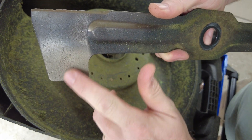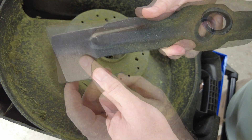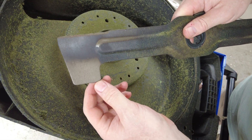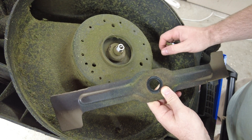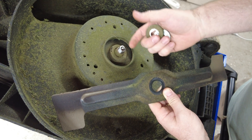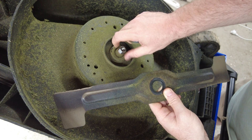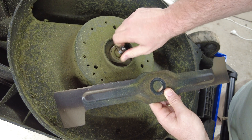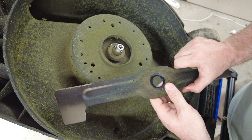We can have a closer look at the cutting edge of that blade now and as you can see it's quite eroded and chipped. That impeller section on the back is also a little eroded. Blades can certainly get a lot more eroded than this. With an electric lawnmower compared to a petrol one, there's a lot less torque, so it's easier for the mower to stall or drop in RPM, and then that impeller system becomes less effective. I also removed the build-up of stringy grass around that output shaft, because that will increase the amount of friction acting against the motor.